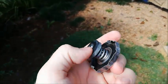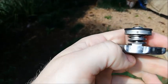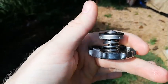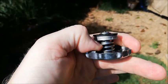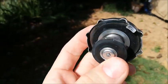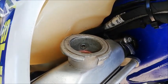Let's talk about the maintenance of these items. Because that spring is constantly moving up and down as pressure fluctuates, this is actually a serviceable item — you should be replacing it out of caution every year. Older bikes tend to overheat and boil out their radiators quickly because the spring has become loose and doesn't hold tension anymore. You also want to make sure those two seals are still in good condition, as they seal off your coolant in the radiator completely.